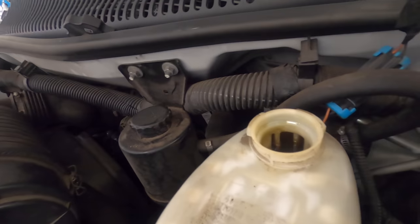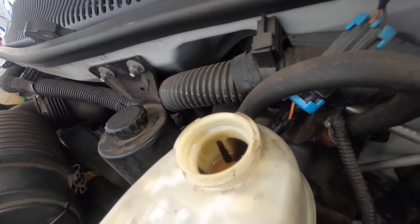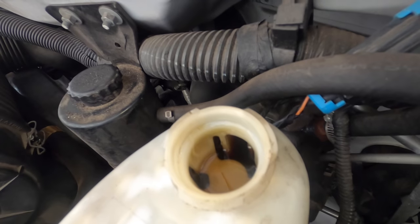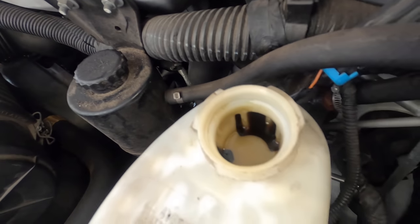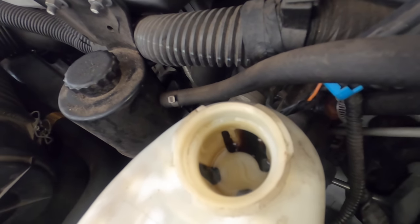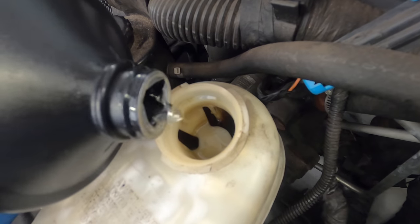When doing this, you must exercise caution to not allow the master cylinder reservoir to run empty, because then you'll be vacuuming air into the system, which makes this job about 10 times as lengthy as it has to be. Because then you have to perform the scan tool automated bleed procedure on the ABS pump, not to mention suck a bunch of fluid in there to attempt to purge out all the air. It's not fun. So this isn't a set it and walk away kind of procedure. That being said, seeing how this is getting low, I'm gonna give her a top off.